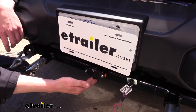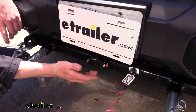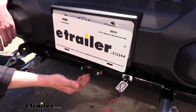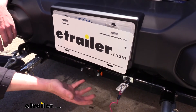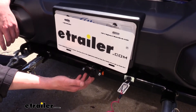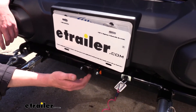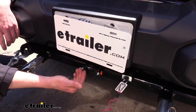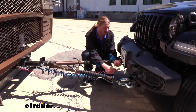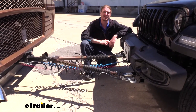If your kit came with a cable you're also going to get a six-pole connector with it. This is the most common attachment point you'll find at the front of a vehicle for a flat tow setup. You need at least four wires on your connector — usually a four-pole flat for lighting — but having a six pole gives us some extra options for additional accessories. We're using a six pole because in addition to our lighting circuits we also need a spot for a charge line cable. Once you've got everything installed, don't forget to plug in your cable and connect it to your motorhome — then you're ready to place it into flat tow and hit the road.